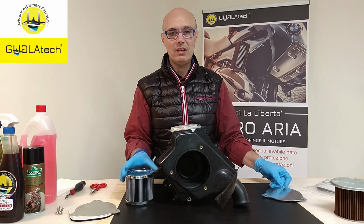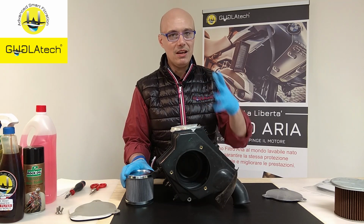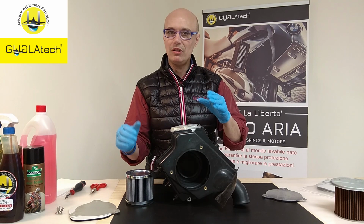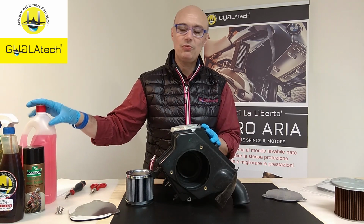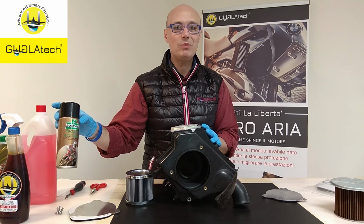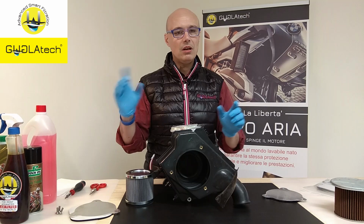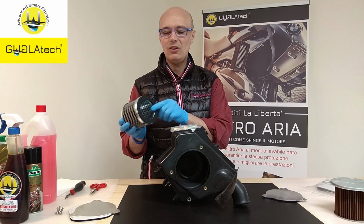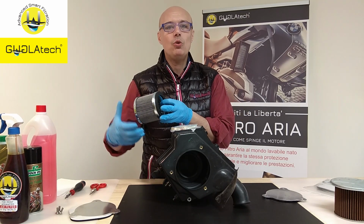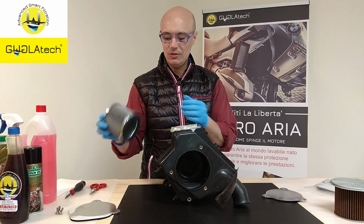Mounting of the filter, quite easy. Oh, remember, if you want to go for a desert or a heavy sand or fine dust, or you want to travel around the world, we recommend oiling the filter. We use a fluid which is specifically designed to be washable in water. It's a great product and we like it very much. A spray just on the outside, not inside, it's not necessary. You don't have to soak the filter. A light spraying will be more than enough for our matrix.